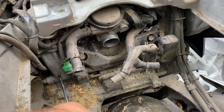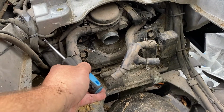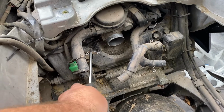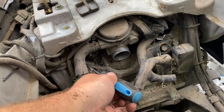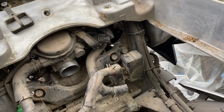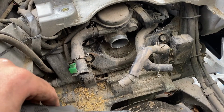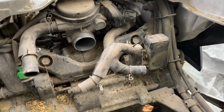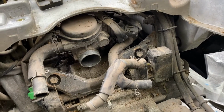So you have this outside piece that runs up to the frame over here, that has bolts going through it. You have the center section of the mount, which has 2 bolts that go into the side of this engine mount, and same thing over on this side. That gives me lots of options as far as mounting this over there into the Ruckus, because I don't have to follow this engine mount exactly, but it is a good reference for me.